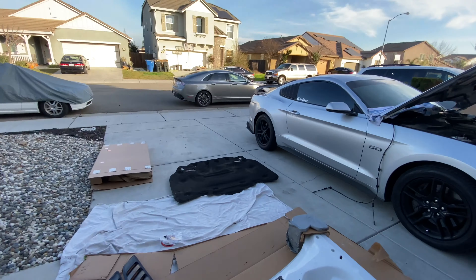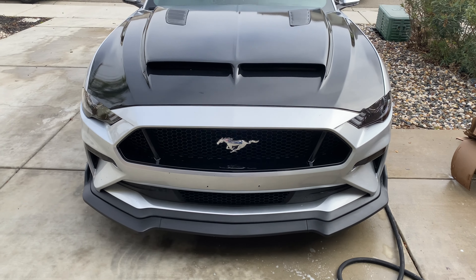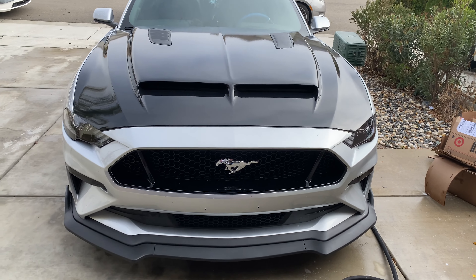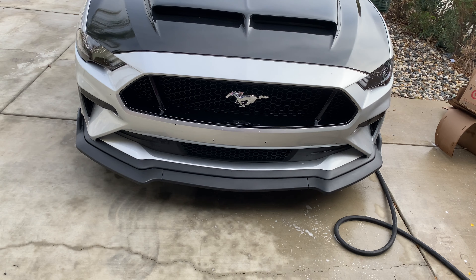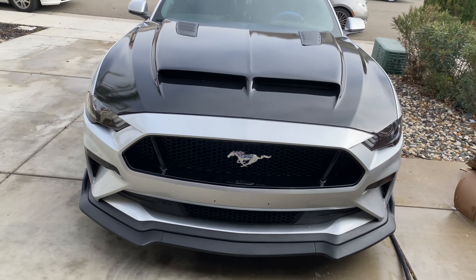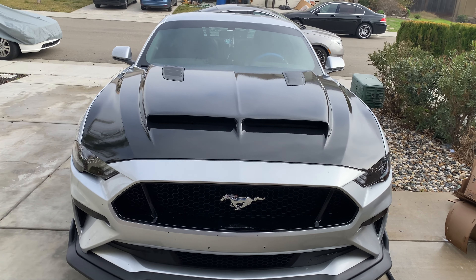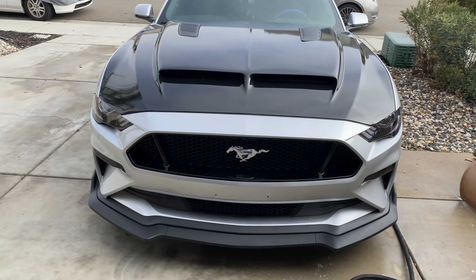Just wanna give a little update. Basically what you wanna do if you're gonna be taking off your hood for any reason — new hood, damaged hood, whatever — you gotta take out all of these push pins, and then you gotta undo the washer line. You basically just pull out the two little sprayers on the bottom and run it out those two holes. The rest are just on push pins which are really easy to come off. The hood's not here just yet but I'm gonna have it off so I get on the ball and get things going.